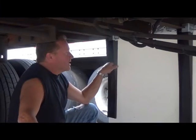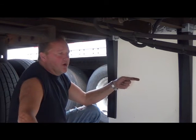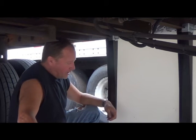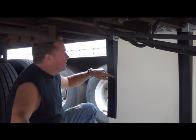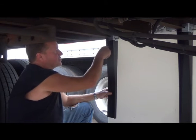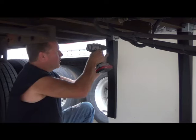All right, all of the stanchions are now secured permanently. All of the panels are now hung temporarily right where they belong, so everything's nice and straight. These stanchions are almost 3 inches wide, and it's important to have a uniform look on the outside for your fasteners. So what you'll see is that you've got a box section right here. You shoot for the center of the box to drill the first hole.